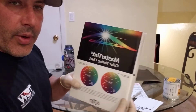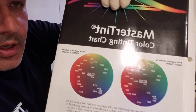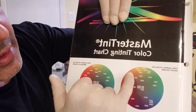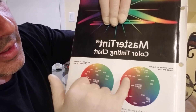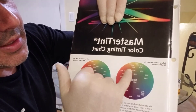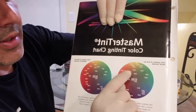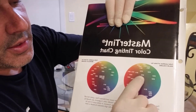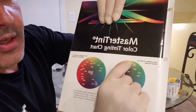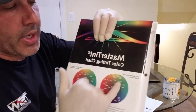One other good point going back to reading this chart: if you're doing a color and it's sitting in a certain range and you want to pick a toner to make it dirtier and yellower, depending on where the toners are positioned on the chart determines how dirty or clean they are. For example, toner 890 is going to be dirtier because it's closer to the center of the sphere, whereas 844J is right on the edge of the sphere, which means it's more rich — it's a cleaner, less muddy toner. The position on the chart tells you a lot about the toner's character.